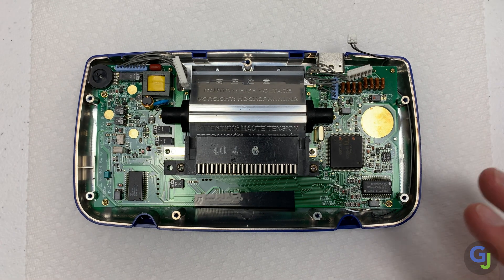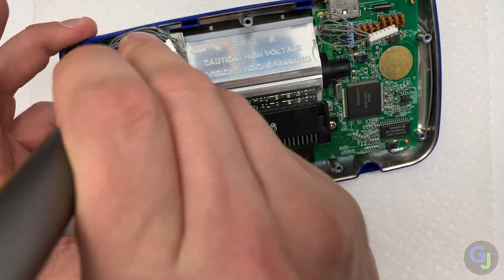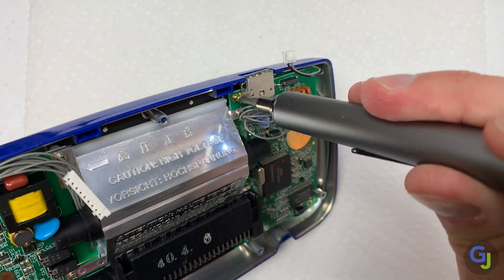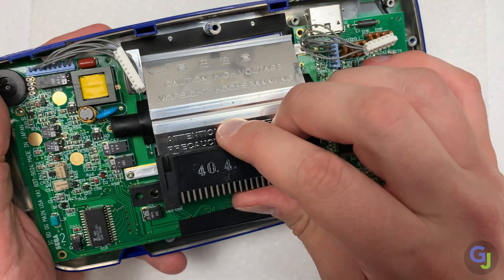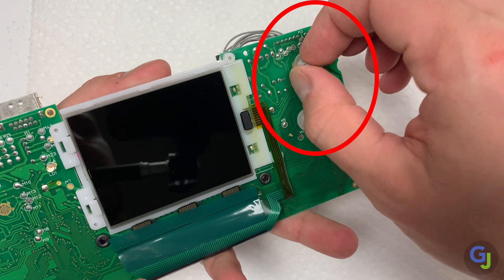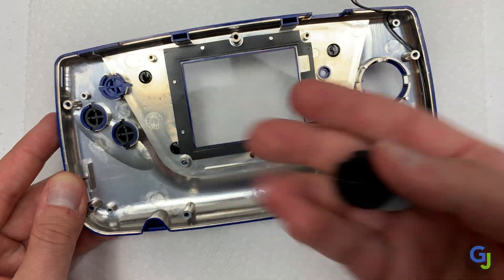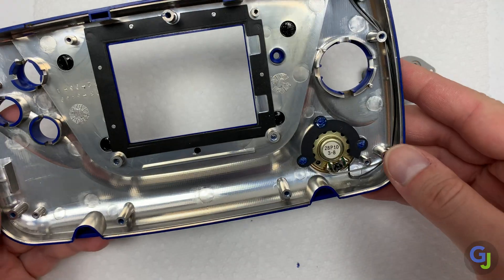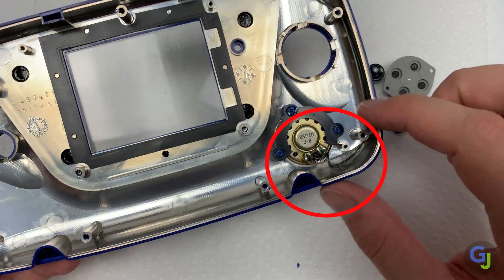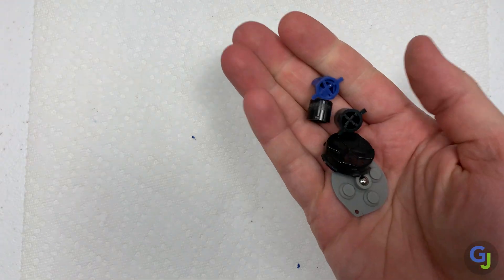Let's first take this out of its housing so it's easier to work with. The main board has eight screws to remove it from the front shell and they're all really easy to get to. Then carefully pull it up from the shell and check for any pads stuck to the front. Over time these can get stuck in place and it sucks to lose one of these small ones. We will get these as well as the buttons cleaned up for the final assembly later. The front shell also has the speaker attached to it instead of the main board — I'm not sure why Sega separated it from everything, but it is a bit of a pain to replace if it ever goes bad.